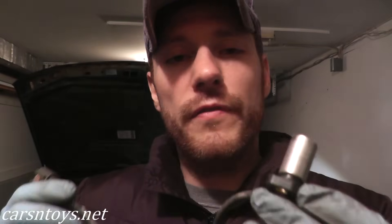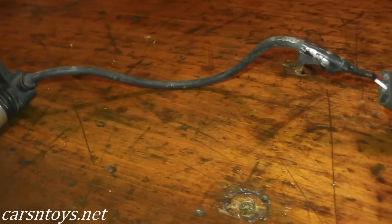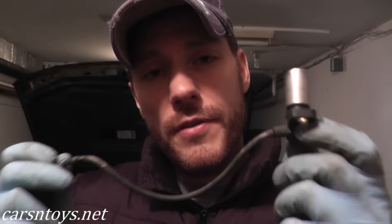Today we're looking at a revolution sensor, also very often called a vehicle speed sensor. It lives in the transmission and it's not inexpensive — it runs close to $150 after tax. If you have trouble code P0720, this is what the sensor looks like. I'll show you exactly where it's located on the transmission; it's only held on by one 10-millimeter bolt and is easily removed.